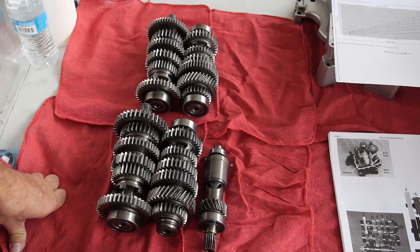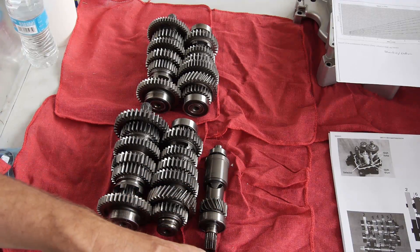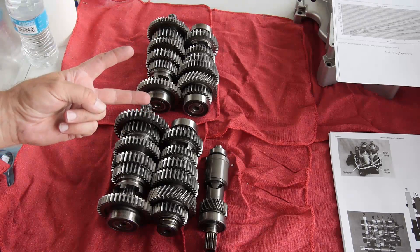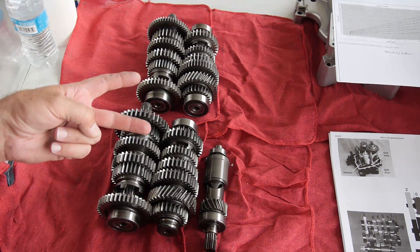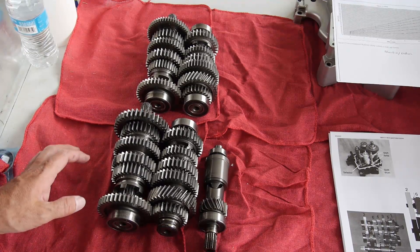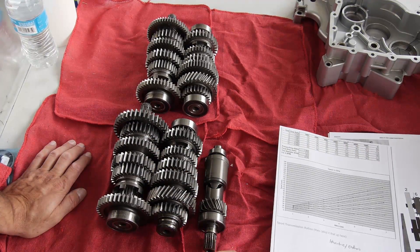The other gears are actually okay. Since the case is repaired, I didn't buy a new or used transmission off eBay. Instead, while waiting to make a decision, I stumbled upon a modification that guys had done to the GS Adventure transmission. The R1150 GS came in two different styles: the Adventure form, with bigger suspension, a bigger fuel tank, and different gearing, or an Enduro transmission with different gearing — and the Enduro transmission had a lower first gear.